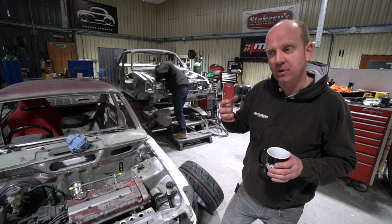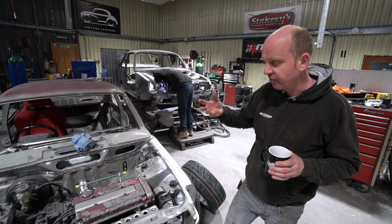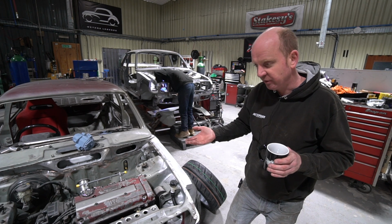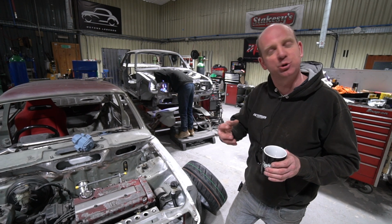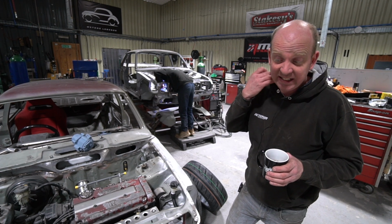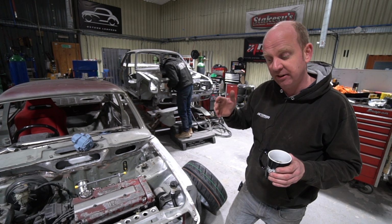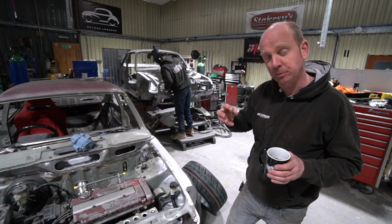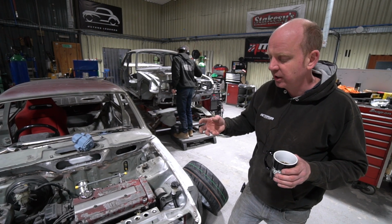While he was here, I asked him about custom-made one, two, maybe three off coolant hose sets. Now, I'm aware of how they're made, we've dealt with this before, and I was talking to him about how we could go about making mandrels for them. Stainless steel tube mandrels I've done before, talking to him about the nuances of making mandrels for custom hose sets. At that point, he mentioned why not 3D print them? And it turns out that Goodflex have the capacity to 3D print mandrels that will withstand multiple trips through their hose autoclave or hose oven, depending on how they're curing those hoses.